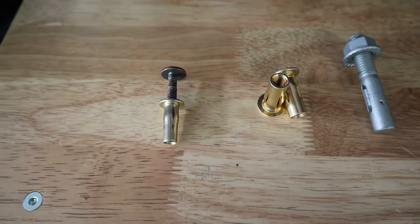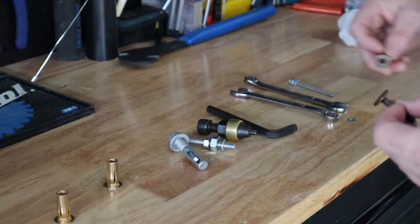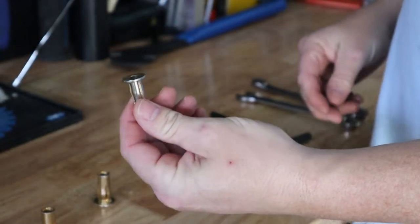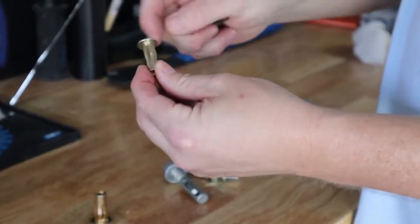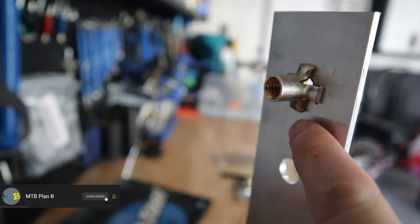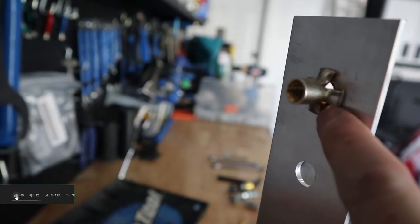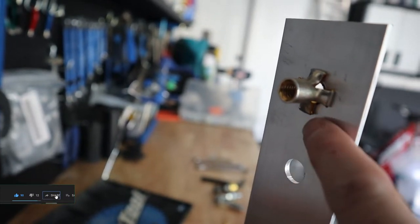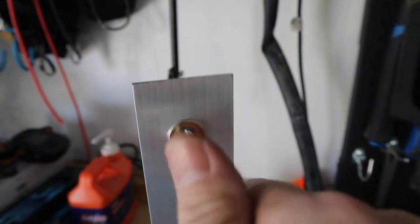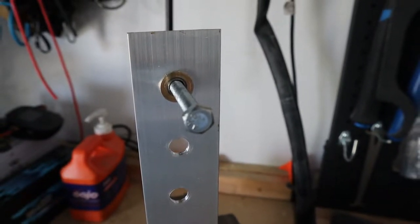In the marketplace there are tons of blind fastener solutions; I found two to be useful in my van build. The first solution is a rivet-style threaded insert — this one has a pre-bulbed rib around it. It works by compressing that bulb so it spreads out into four legs on the back, gripping the surface. That compression fit against the sheet metal lets you screw a bolt into the threaded insert to affix whatever you need to the walls, ceiling, or floors.